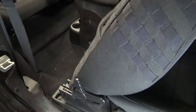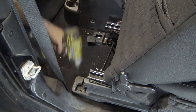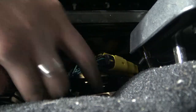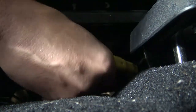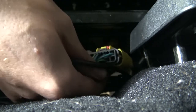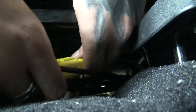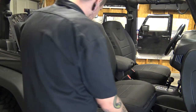I'm going to go ahead and take out the rear liner. Before taking the seat out, there is a harness in here — it's a yellow harness with a red safety tab that you have to pull back, then squeeze. Sometimes it'll come off its little base, so you might have to use two hands. With the bolts out and the harness unplugged, now you can just lift the seat out.